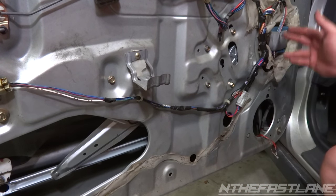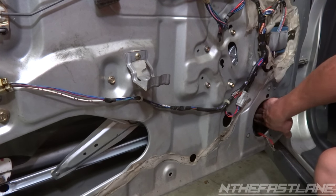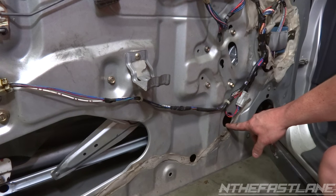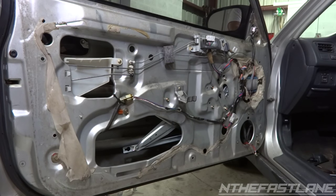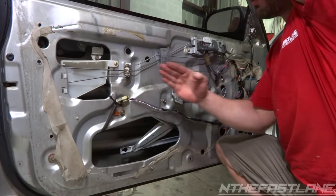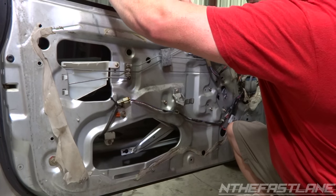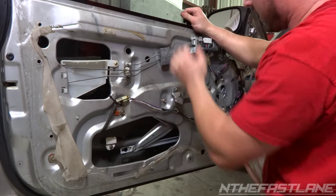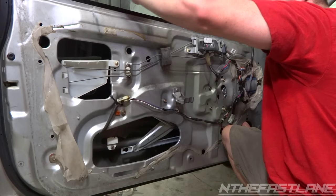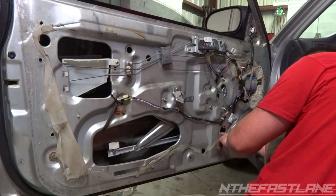To make things easier, I'm going to take out this guide, loosen this bolt and completely remove it, then slide it back a little so I can work the window onto the track. Now here comes the tricky part: the window that's taped up at the top — keep it in track and slowly slide it down. We have to put it through those holes on the regulator. Hold it toward that side as you're coming down, and get your hand under the speaker area because that's where it always falls first. Pull the track a little and slide it over those holes.